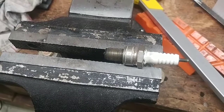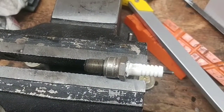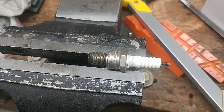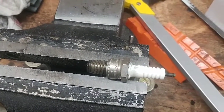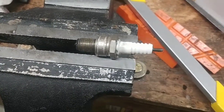They give you an instruction telling you which color is good, which one is too lean, which is too rich. When it's orange-yellow then it's too rich, when it's white then it's too lean, and if it's a Bunsen blue colored combustion then you're right at the sweet spot. I ordered the Color Tune for this motorcycle here.